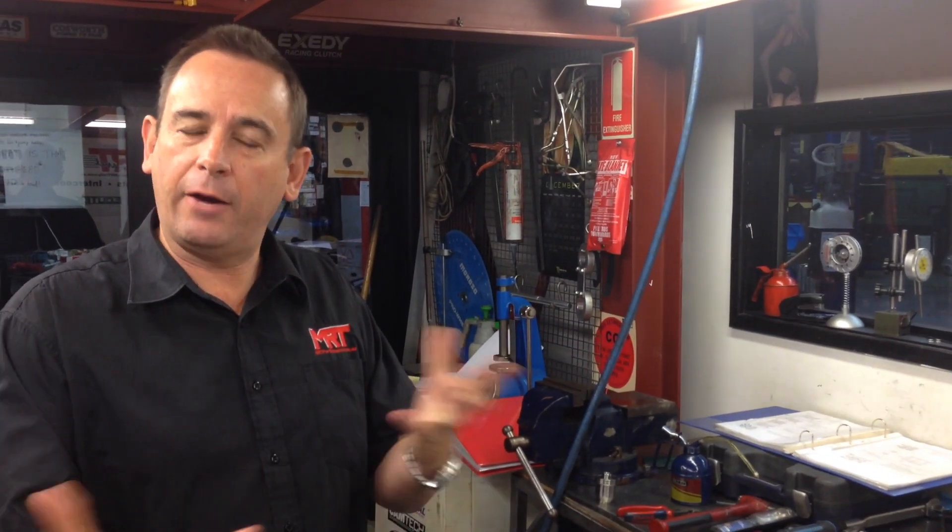Hi, I'm Brent. Today we've got another video update on the internal workings of the Subaru FA20 engine. This particular engine is the BRZ Toyota 86 engine. It's normally aspirated, so it runs 12.5 to 1. It's the direct injection combined with port injectors on the inlet manifold, unlike the turbo version, which is available now in the Subaru WRX with direct injection only.